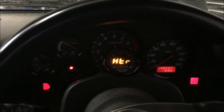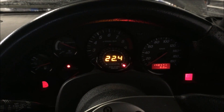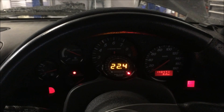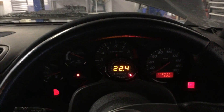You can hear the fuel pump prime. Down there we've got the USB plate cable plugged in, which connects to the USB cable at the back of the stereo from the Adaptronic. Here we go — full Android. Up here you can see the wideband; the heater is currently going. These sensors have a heater built in, and an interesting fact: I've seen people waiting for the heater to finish before starting the car, but I found that actually damages the sensor due to the shock of cold air followed by hot exhaust. So it's very good practice to just start the car right up and not wait for the heater.